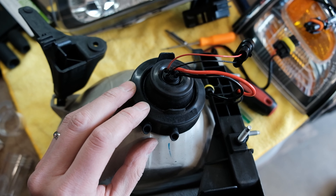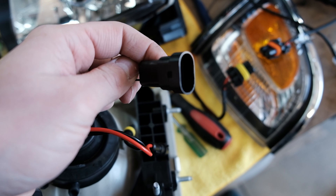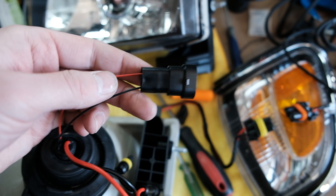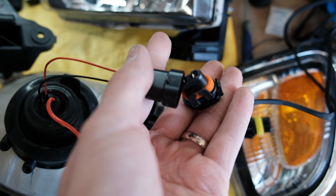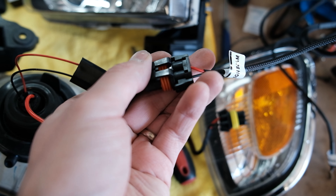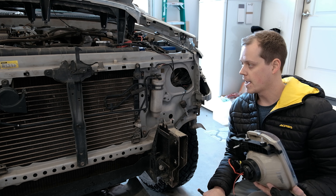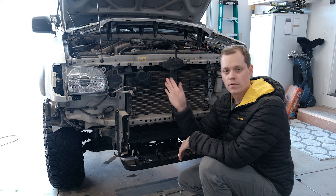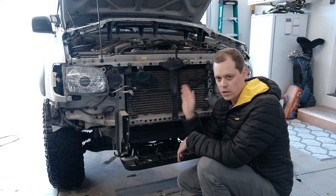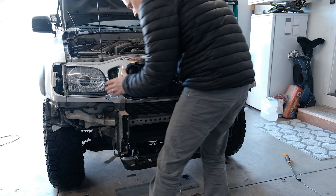It is wired up — you can see this is on there and it's a nice seal. I ran those cables into the plug that it comes with, and there are little rubber seals down inside. Make sure you pay attention to where the positive and negative go, and make sure they match up to the high beam. Match up the hook on the clip with the hook on the connector. Now for the install, we're literally going to reverse the process we had before. Now that we have the headlights in nice and tight, we can go ahead and install the grill again and replace any clips that may have broken when taking it out.